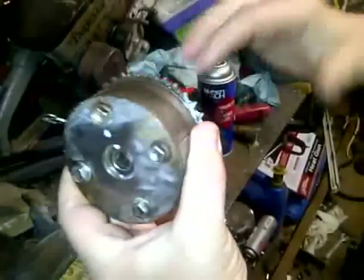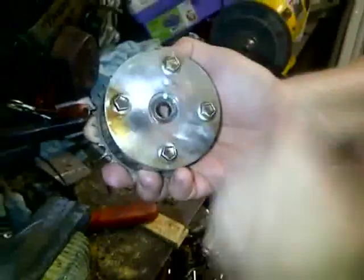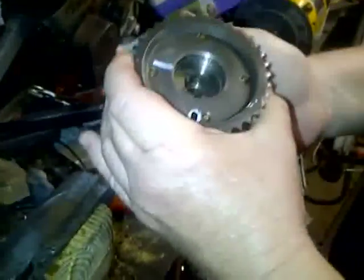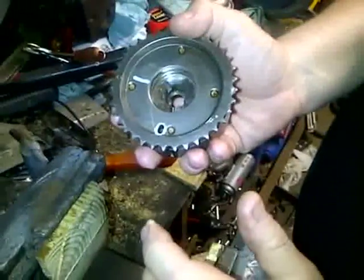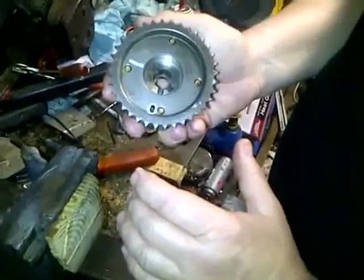I had trouble finding it on the internet how to do it, other than some reading, so I really didn't know. What they tell you to do is look at it from the front — this would be the head this way, this is the front — and you have some holes. If these two holes, the hole in this and the hole in that, line up, then it's locked and you have to unlock it. To unlock it, you have to put 21 pounds of air pressure into the hole, which is pretty much the same thing as oil flowing through it. A valve opens up and oil pressure actually opens this up, so it'll turn back and forth and vary your timing.